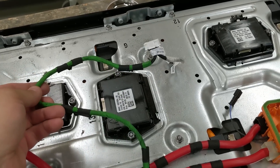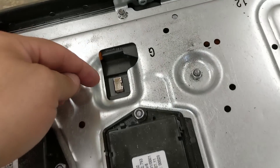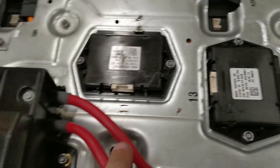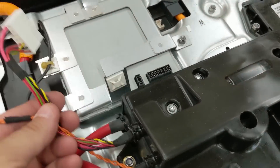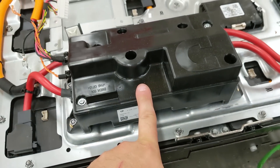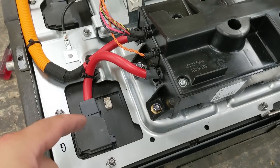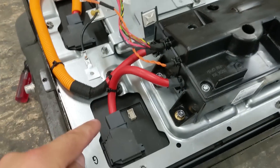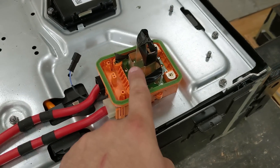I've pulled all these little data wires — these are sensing the voltage of every individual cell. The individual cells communicate back to these computer modules, which all feed into this larger computer, which sends signal into this module. I assume inside here are the relays, so this is the main positive and main negative, and the relays are why we don't see voltage at the external posts.